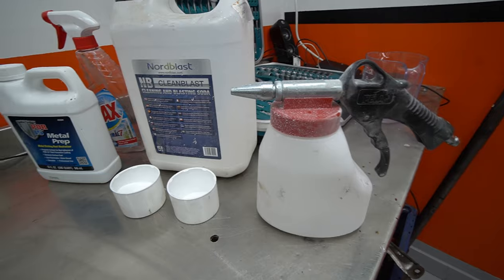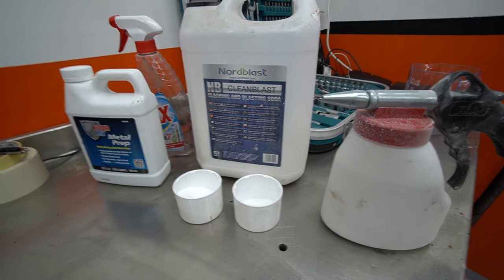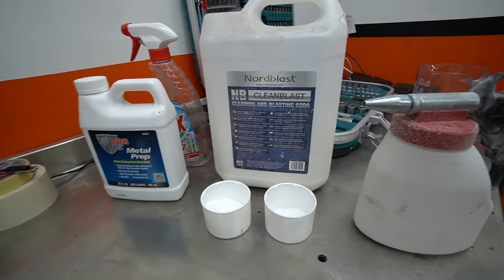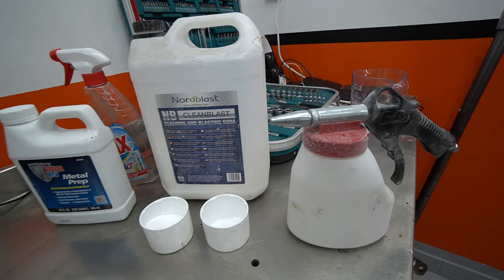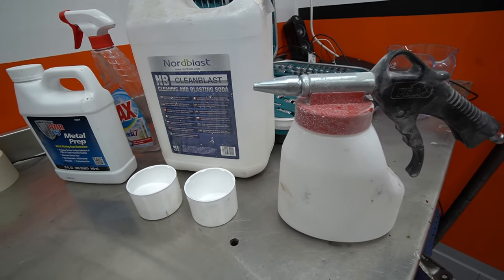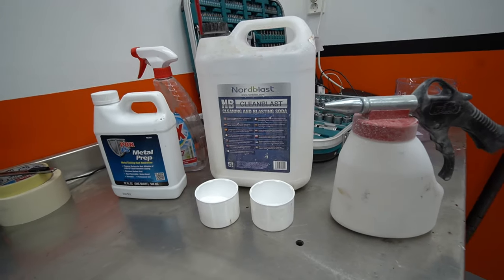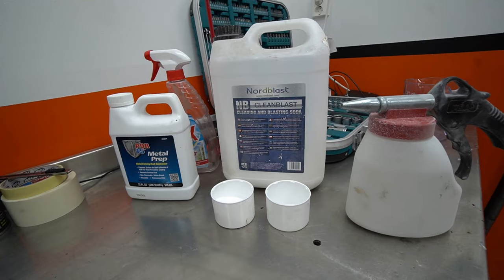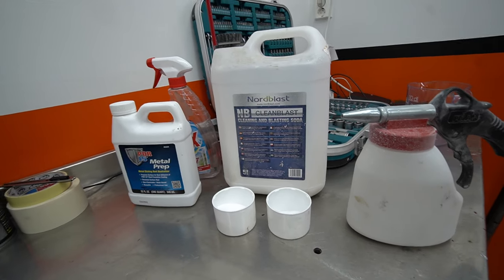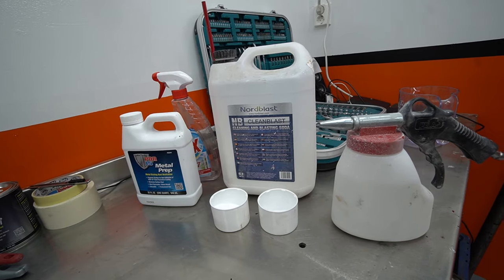It's great for gentle blasting of smaller parts, like getting carbon off engine valves and just general small sensitive parts blasting. But for this project, blasting aluminum oxide off my block, I can't recommend it. The process was insufficient, very dirty, and left me with a lot of cleanup to do. So just buy plenty of the cleaning chemicals from the beginning and leave out the blasting process altogether. If you really want to blast the engine, maybe ice blasting would be somewhat more appropriate, because this just didn't have enough power.